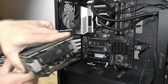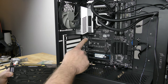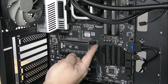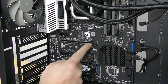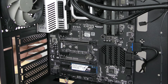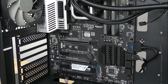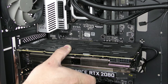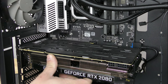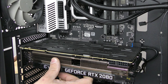Now I'm going to insert the EVGA GeForce RTX 2080 Ultra Gamer. I'll zoom in so you can see how to install a video card. You'll notice this little retention mechanism — it's locked here and open that way so you can slide in a video card. Match these three prongs — they're going to slip into the little holes right inside the case — then push it through the PCIe slot and you'll notice this little lever pop right back out. Pretty easy, it clicked in place.